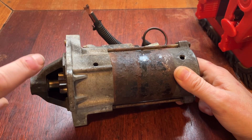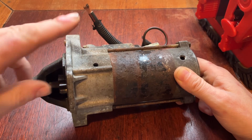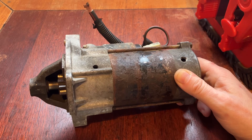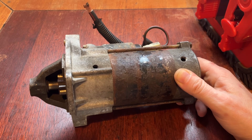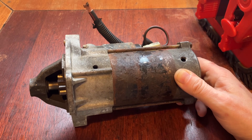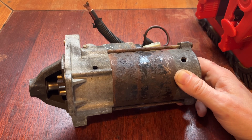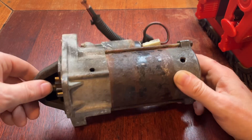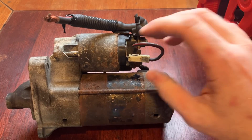It comes out on a twisted helical gear, which means as it comes out it does so a little bit smoother and softer. When it hits the flywheel it doesn't damage it as much as hitting it square straight on, and that increases the longevity of the flywheel and the starter motor. That's why it's called pre-engaged - because all this happens before the motor starts.